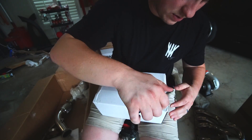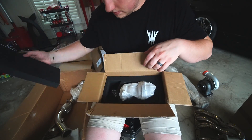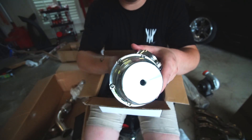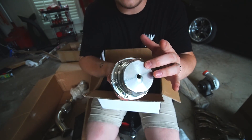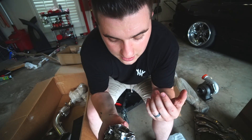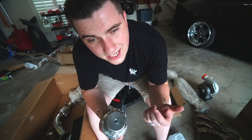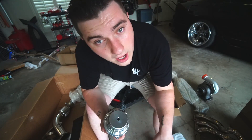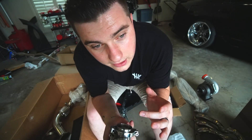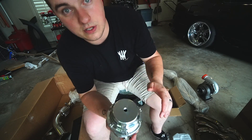I'm going to guess this one is the wastegate — and I'm correct. It's a 46mm wastegate, shiny, and it's a tial style, which is really important because we have extra tial springs laying around. Wastegates are super important — long term, this can be a huge fail point for a car. You've got to make sure you're not using too cheap a wastegate, because if it ever gets stuck closed, your motor is gone. Wastegates open at a certain boost pressure to control boost. If it never opens, your boost pressure never stops rising — and that's usually what blows motors.